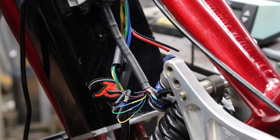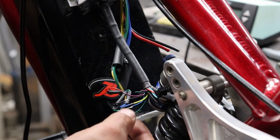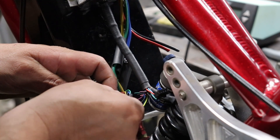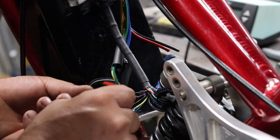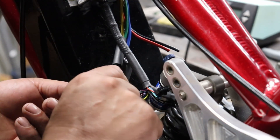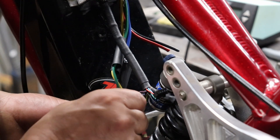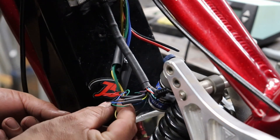And that is it. So now with that funky reconfiguration of what they have, this is more than likely going to work, because this is a combination that I've found with Kelly controllers to work on every motor that I have tried. I don't know why — maybe they can change that — but for now, that's what we got. I'm going to go ahead and put the shrink on, but not all the way. Just like the phase wires, we don't want to completely shrink this until we are 100% sure this is all the way it goes — kind of like a pre-check on everything.